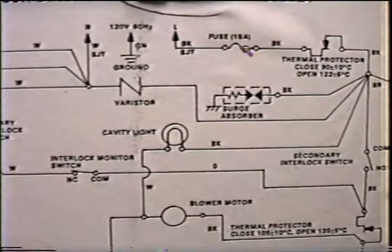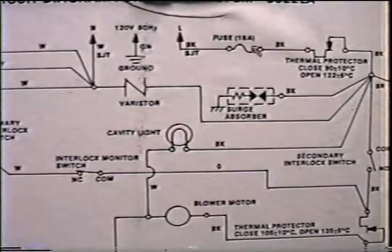I would advise to put a piece of copper in here. And this is what they call a smoke test. If you do this by putting a copper tube in there, I would be very close to the plug so you could jerk it out quickly if it starts to smoke too bad. But once the part starts to smoke, definitely unplug it. And the part that smokes is definitely the culprit, and that's why it's blowing the fuse.